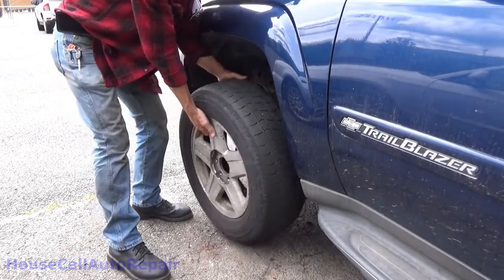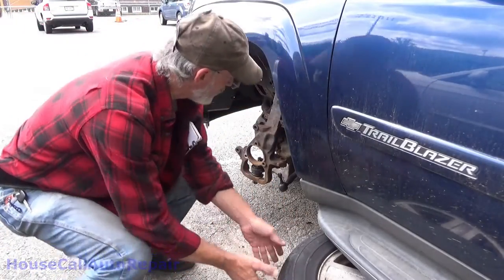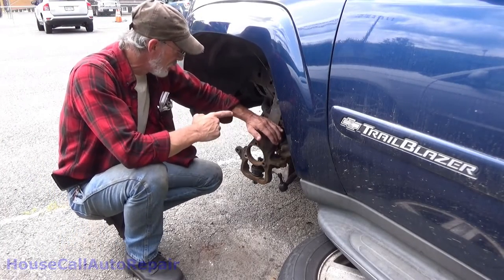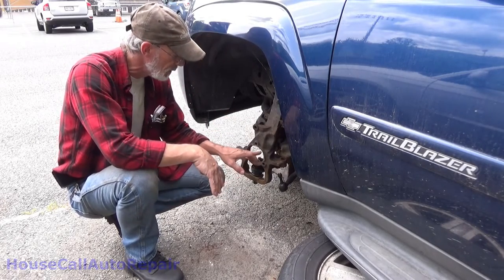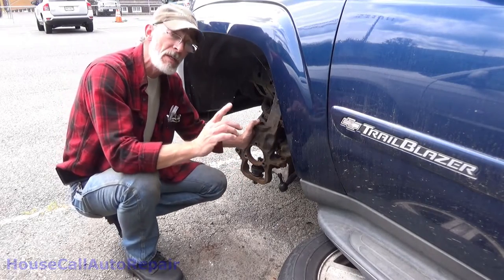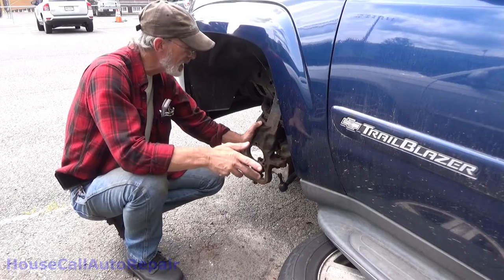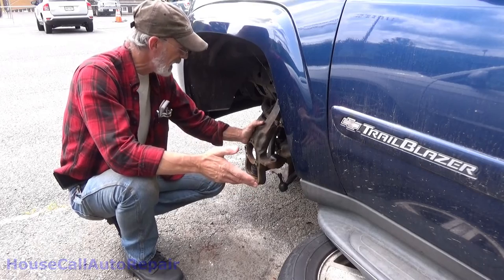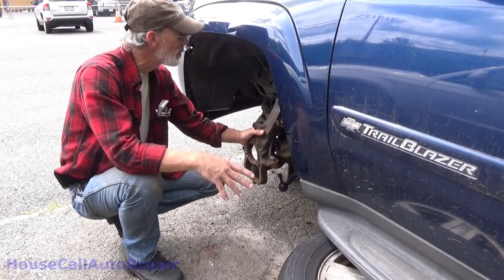And we're back again — it's time to put the wheel bearing in. We weren't able to get the steering wheel boot or the rack boot for the other side and the sway bar links; we'll worry about those at another time. So we're just going to put the hub bearing back in, torque down these bolts here. I've brought my torque wrench along because people have been beating me up over it. I'm going to do the best that I can with the torque values — some of them are pretty consistent across all the research I've been doing and some of them are not, so we're going to set up the torque wrench at a happy number and see how it feels.